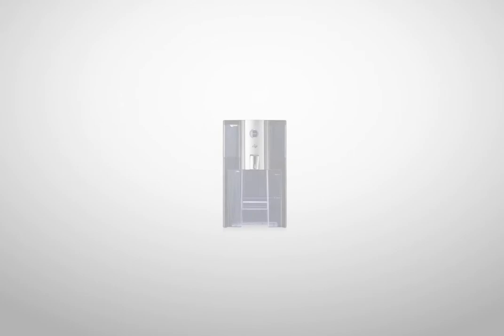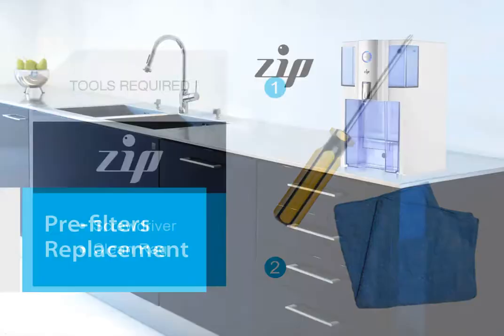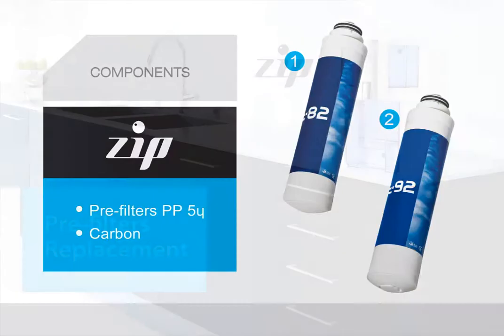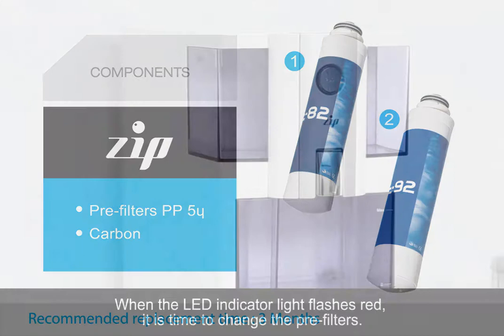To replace the filters and the RO membrane, all you need is a screwdriver and a clean rag. First, replace the pre-filters. There are two pre-filters, a PP filter and a carbon filter. When the LED indicator light flashes red, it is time to change the pre-filters.